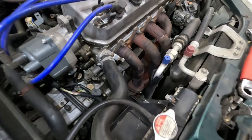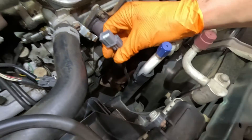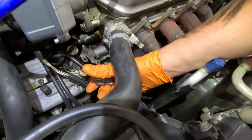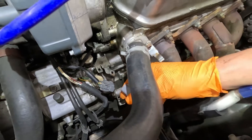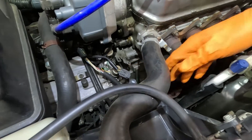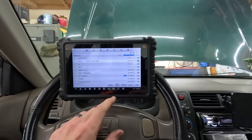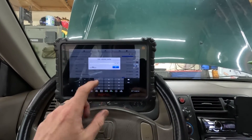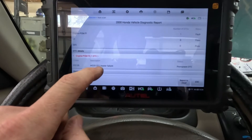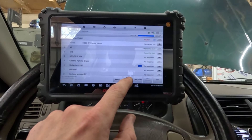So we're back on this side of the engine. The part is installed. You can get your harness — we're going to plug it back up, and then we'll hook it back onto this bracket. Let's go reset our codes. This scanner is not playing with this car nicely at all — it took forever to do this. But now I'm going to report, which is pretty much what we already saw earlier. We have it for our oxygen sensor heater failure, but I just want to show you there are no other faults in this car.